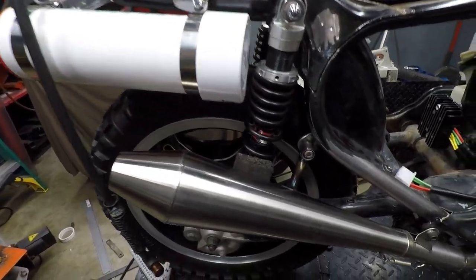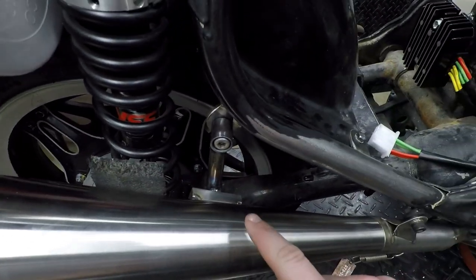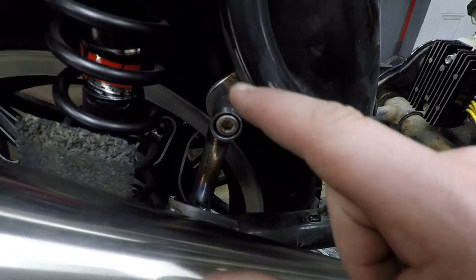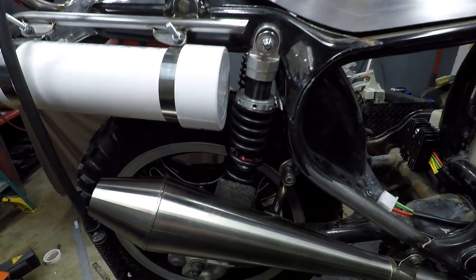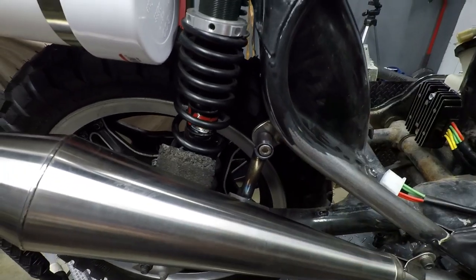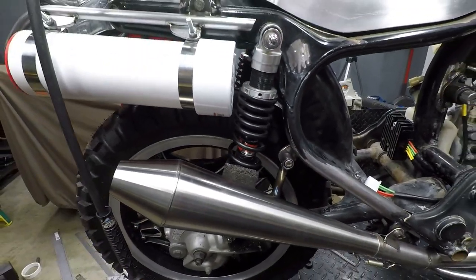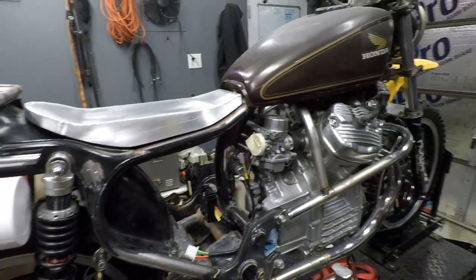I relocated the exhaust mount here — cut the bracket off, it was just tacked on back there, and relocated it further forward in front of the shock. Made a larger yet shorter hanger system, and this is now tied into the frame here instead of being up there. A piece that was that long had some side-to-side distortion, but this is a lot more sturdy. Kept it with the shock angle because I'm picky like that, and it's supported here and here — that should be completely fine for this muffler. I'm going to wheel this thing outside and get some good shots of it.